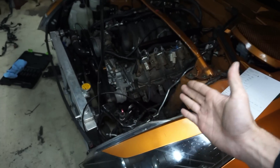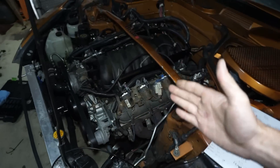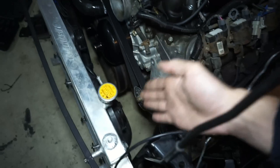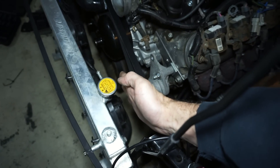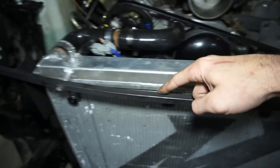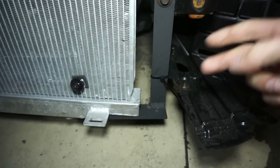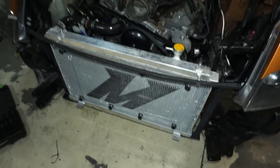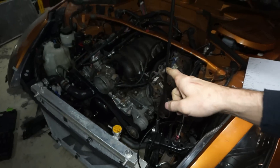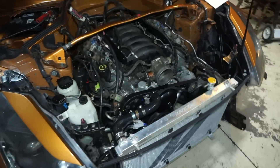With the engine farther forward there's a fitment issue with the radiator. The other more expensive kits are designed to work with the factory radiator placement. To get around it, I moved the radiator forward a couple inches and down a little bit, built a bracket from bent square tubing, and used the factory AC condenser mounting point to hang the radiator. It's a Mishimoto radiator that was already on the car. I drove it around and let it idle for about an hour and it only got up to 194°F — so it does pretty well.